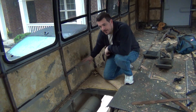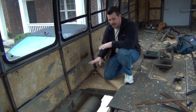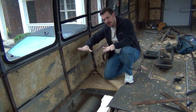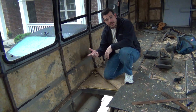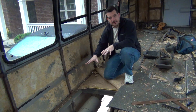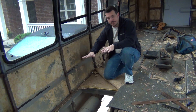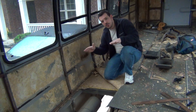I've already removed all of the side rails from the bus, and now it's time to remove all of the flooring. The floor on this side of the bus has kind of sunken down, so I need to take all the flooring off: one, because it's OSB and needs to be replaced with real plywood, and two, I need to structurally fix this side of the bus so it's level and my flooring doesn't bow down on the ends.